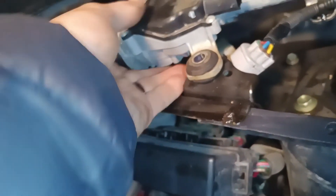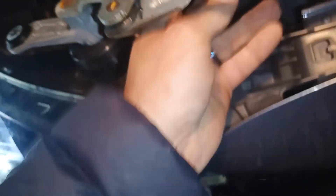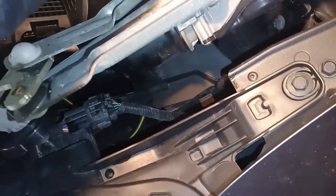And this is what we want. If I just touch it, the motor is actually pretty warm — it's been obviously forced. Once I lift it off, I'll show you the problem. I think the problem is right here on the underside — this is bent. I don't think this should be touching, and it's also catching this bolt. I think that's what's preventing it. It's supposed to actually go in a circular motion all the time, but obviously it can't go past this point — it gets kind of locked.